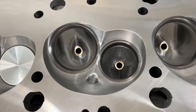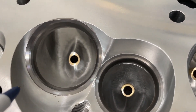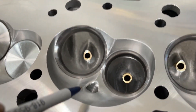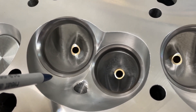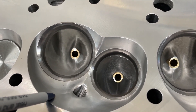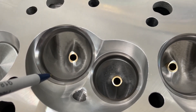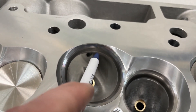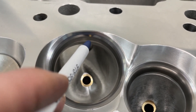This has a 2.25-inch intake valve and a 1.88-inch exhaust valve. The CNC work — these are fully CNC ported, not as-cast. Full CNC ported all the way through the intake port, exhaust, and chamber. The chamber has one of the smoother finishes. When you order the full CNC heads from AFR they have a finer finish on the chamber, which helps flow. The valve job looks pretty good, but you can tell they must have dropped the valve job down because there is a slight lip here that you usually don't see — not a big deal.